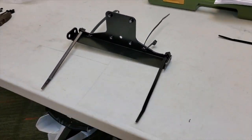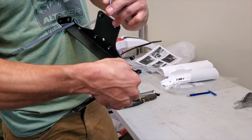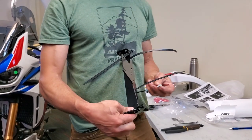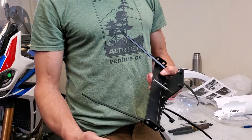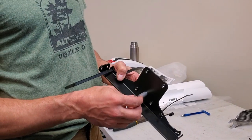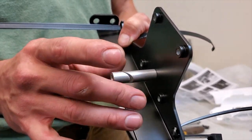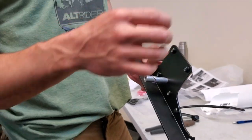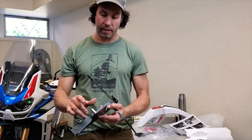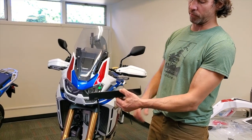Now we're going to queue up our first fasteners. We spent the time and went ahead and put PEM fasteners on there, making this really easy to mount your fender — you're not trying to fight to find your nut up at the top. To make this even more robust as it attaches to the triple tree on the clamps, it's also going to get a quill fastener. This expanding quill goes into the steering stem and will swell, giving us a lot more rigidity for that front fender at high speeds — north of dirt bike speeds of 60 miles an hour — so we get the extra strength and bite from that quill along with the two side triple tree mounts.